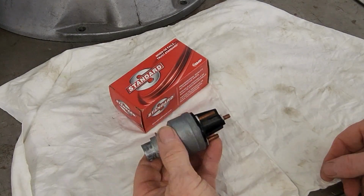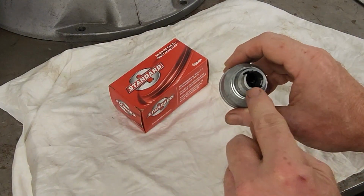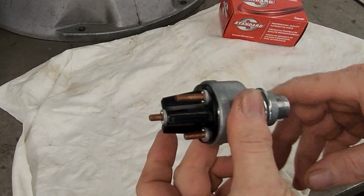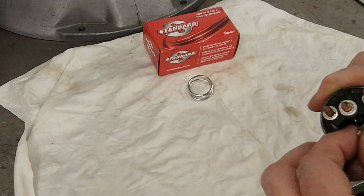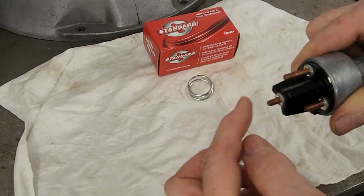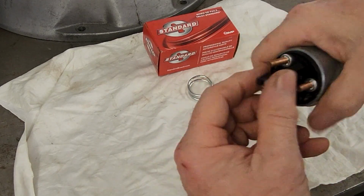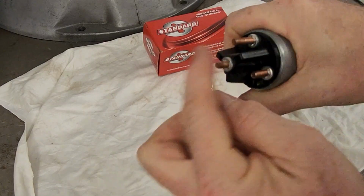Okay, so this is the old ignition switch, okay? And you can see in here it's got a groove cut out here. I had to get the same one, almost the same one, anyway. So the poles in here, that's kind of normal until you tighten them, but see how that one's pulled more than that one? So it was internally made wrong to begin with. This moves in here, in this socket here, so the crimping isn't so good.